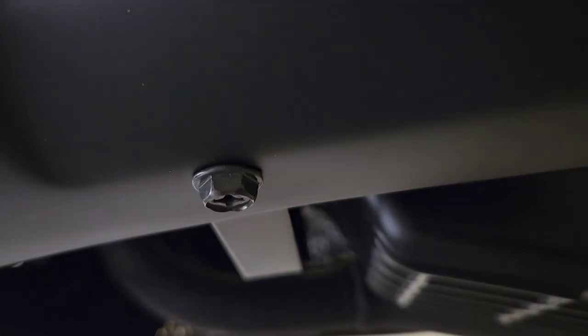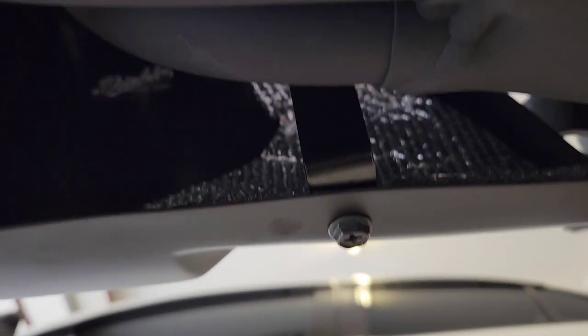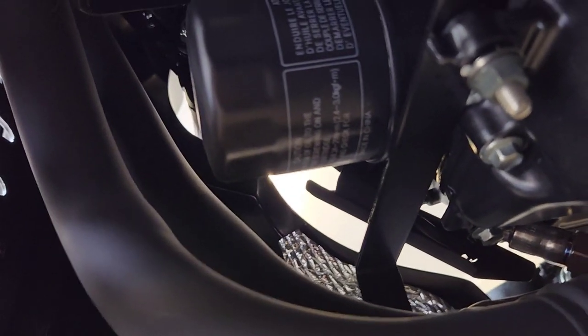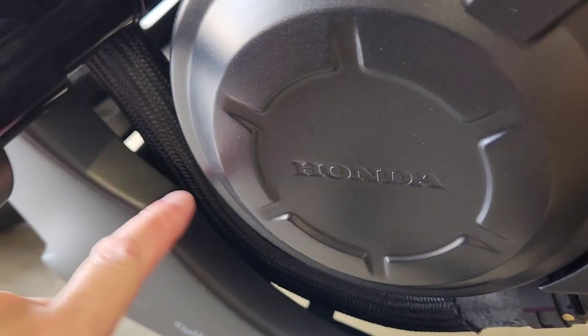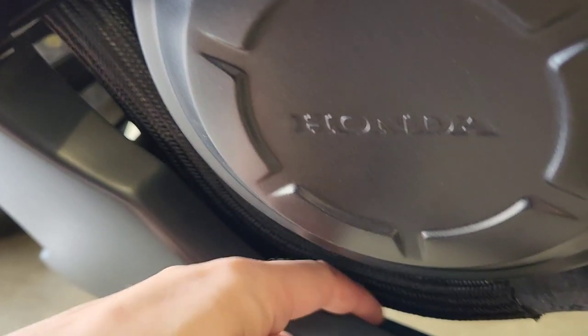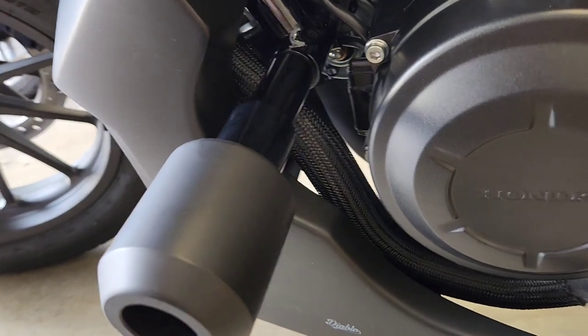Okay, so it all fit together really nicely. As you can see, I've got the nut and bolt here. And on that side, the bracket goes over the headers, and there is a nut and bolt in the center. So with this bottom bracing, it spaces out the fairing so it doesn't touch. It's got a full finger between the fairing and the radiator hose. Doesn't catch or touch anywhere all along.